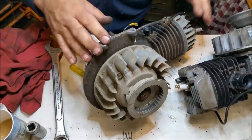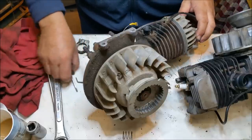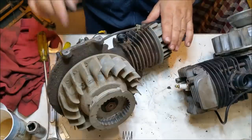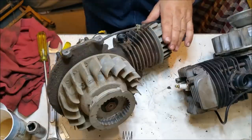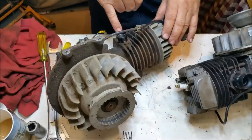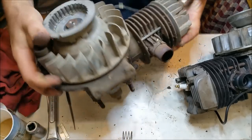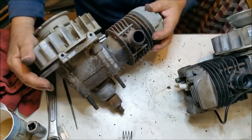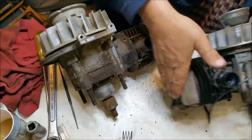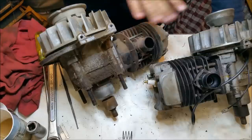Okay, so looking at these engines, got loads of bits now. These two are the only two I'm absolutely not going to touch. This is the 125 off the rubbish pile that was in the Mayfair. It still has its hone pattern inside. It looks perfect. The sides of the piston and also on the bore, you can see the bore through the inlet and the exhaust port. There's absolutely nothing wrong with it, and pulling it apart would be silly. The same with this 160. This is the one out of the orange utility that I got from Norm. This is perfect. That's absolutely fine.